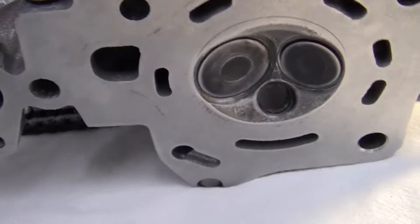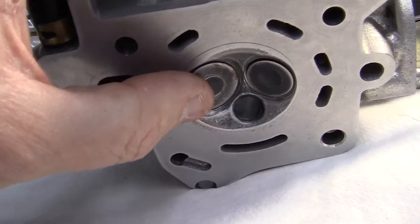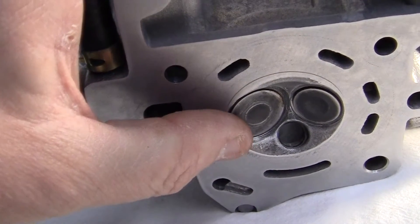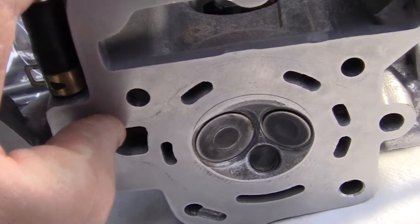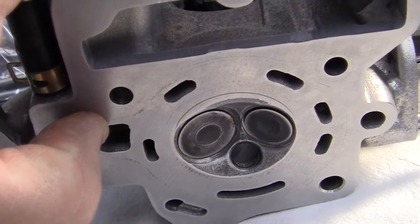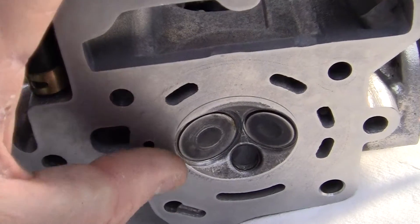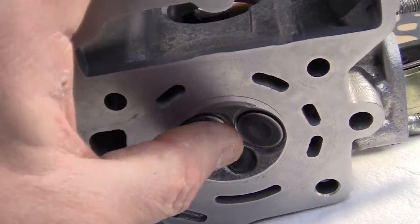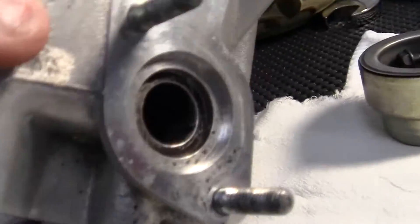It's just enough to allow your intake charge to go in from right here. The intake charge will go in, then you'll hit your compression stroke. The piston will come back up and your exhaust valve will open a little bit and send your exhaust right out there.